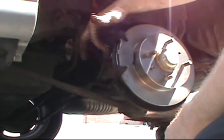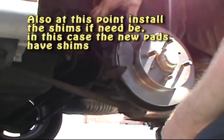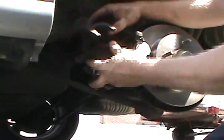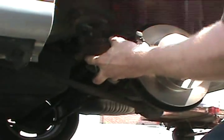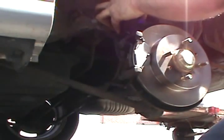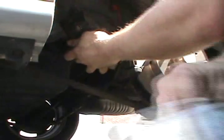Put that into your bracket — remember wherever there's going to be metal-to-metal contact, apply grease. Before you slide the caliper on, you've got to square one of those notches up with the back pin on the back pad. So when you slide that caliper in — that's what you see me doing now, I'm squaring it up — it slides right in and one of those notches slides right into the pin.